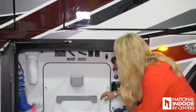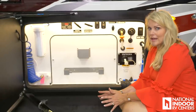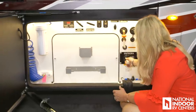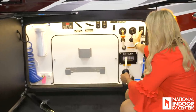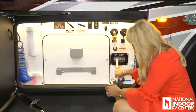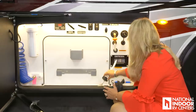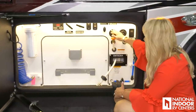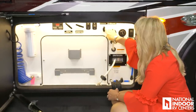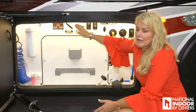Here is our wet bay. We have a light so we can see what we're doing if we come into a campground late at night. We have our power water reel — once we hook that up we can push it right through that little seal so we don't have to worry about rodents getting into the coach. We have our sewer rinse, our fresh water connection — turn the valve this way to fill the fresh water tank, or vertical to hook up to city fill — the light, our macerator on and off button, and manual pulls for our gray and black tanks.